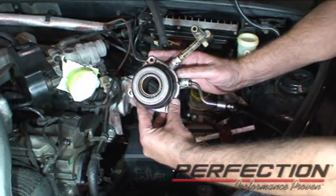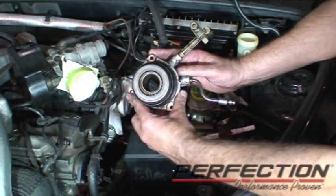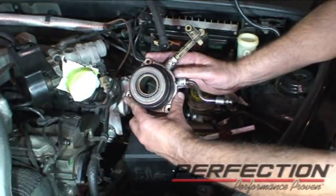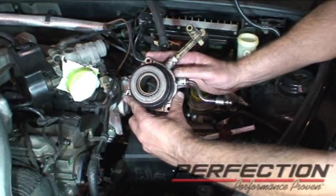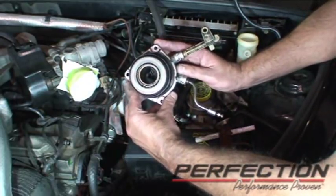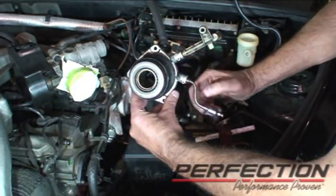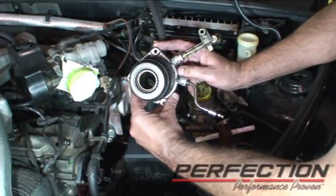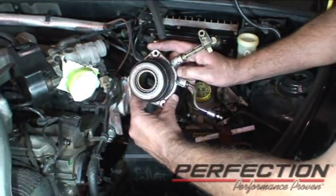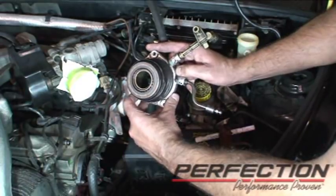It's time to bleed this system. In my experience, traditional brake bleeding techniques — pump the pedal, hold, open the bleed screw — are very ineffective on almost all clutch hydraulic release systems. This one has an extra twist: when mounted on the front of the transaxle, the pressure line connection is the high point and the bleed screw is the low point. So if there's an air bubble, it's going to be up at the top — that's where air wants to rise. As you're trying to push fluid down, you're trying to push a bubble down, and that's a challenge.